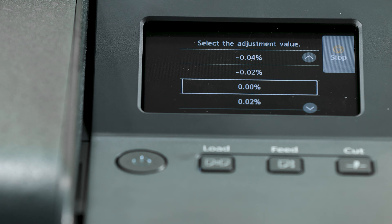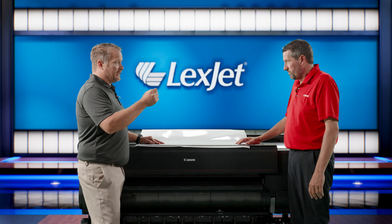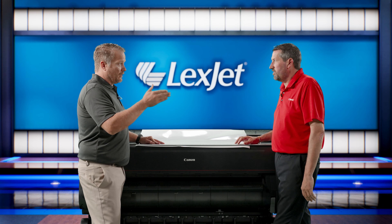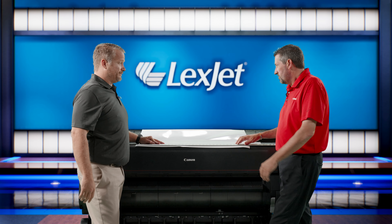The instructions walk you right through it. You tell it what media you're printing to because it is media specific. It's going to ask whether it's roll one, roll two, or sheet-fed paper. It will print it out, and after it's done printing it will have you measure it. On the control panel it will tell you to adjust - if it's perfect right away you just enter zero percent. It's in increments, negative or positive depending on what you need. Then you print it again and check if the adjustment fixed it. You keep entering adjustments until it lands on zero adjustment needed, then you hit zero and it's finished.